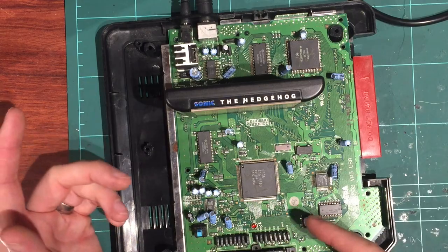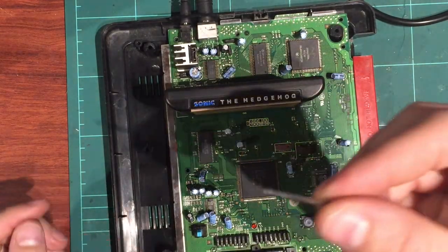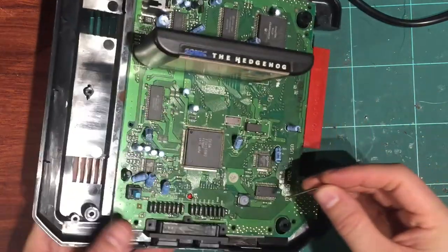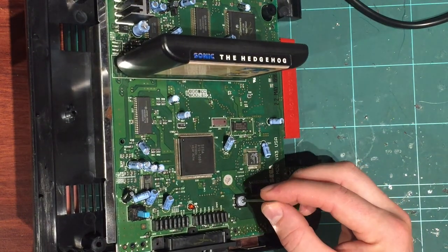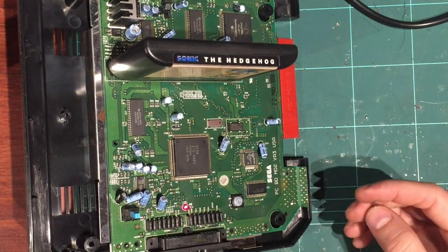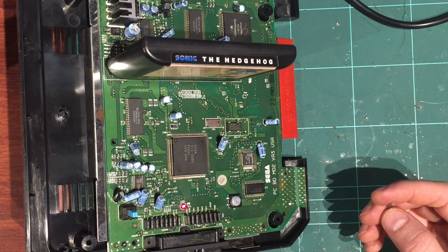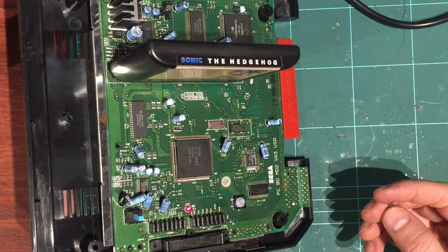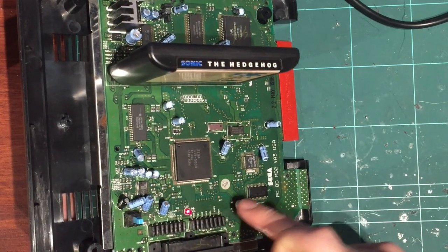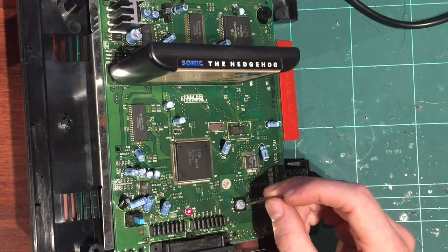There are other videos on YouTube showing how to fix this - some guys use tape and all sorts of things. What I like to use is a box of household nails. You get one approximately the right size to fit perfectly in that reset recess. The head fits in perfectly. If you push it normally nothing happens - that's what the problem is. But if you put this nail in, it resets fine. It's just like a really direct press.